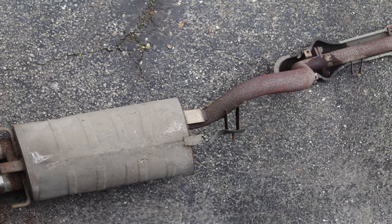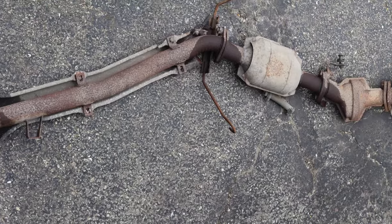We're calling it a day there. So we got a lot accomplished. First of all, the biggest thing was getting the old exhaust off, which is fully removed. And if anyone wants it and can pick it up in the Chicagoland area, you can have a full 12A '85 RX-7 exhaust, as my dog is going crazy inside. I apologize. We got some coolant lines ran. We bled the brakes, which was huge. And we went to go bleed the clutch, but we need a new clutch master and clutch slave cylinder. They're just really gunked up and not worth putting on the car. So those will be ordered tonight. And I think that's it.